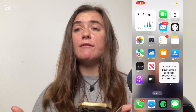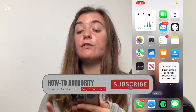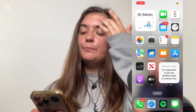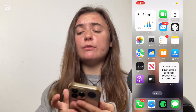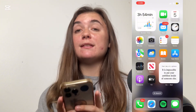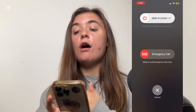But if you're certain that you have a SIM card in, there are a bunch of different ways to get it back up and working. The first of which is to restart your phone. This is always the first thing I recommend doing if there's any problem with your phone. A simple restart often gets everything working as it should, and it's super simple to do. You're just going to press and hold the power button and the volume button at the same time until the slide to power off comes up.